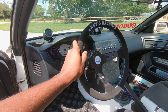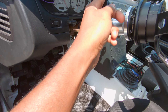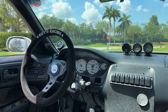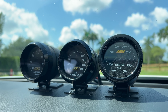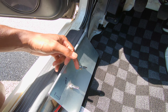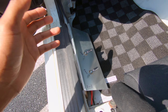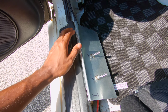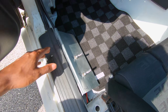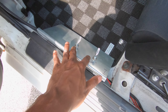I got a Keys 330 millimeter suede racing wheel, imported by Jesse Streeter. It's got an NRG quick release with an eBay generic hub spacer — I think it's about two and a half inches. Glow shift tach, AAM gauges: air fuel ratio, oil pressure, and water temp. This is a custom dual control fan panel, so it controls both of my electric fans separately. I took some sheet metal, double-sided it, put it on here — this is hardwired with no relay for the fans, just two inline fuses going to heavy-duty switches, and that goes straight to the e-fans.